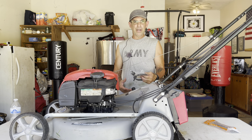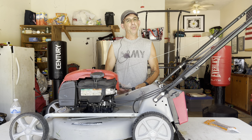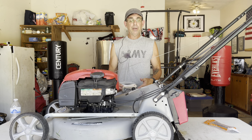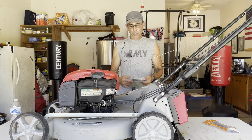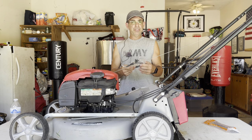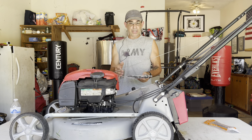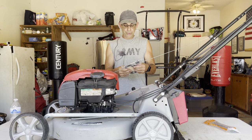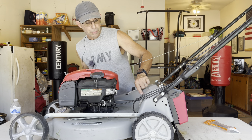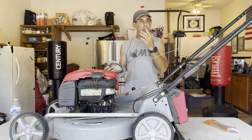When you're talking about this style lawnmower in the industry, we usually refer to them as a push mower - even though this one is self-propelled. It's a little 20-inch pusher; it could be 21, 22, 19, or 18 inches, but we call it a 20-inch pusher. We're going to install a new self-propelled cable which engages the transmission from the operator's bar. His cable is trashed. The model is 479904 - this is a self-propelled model, pretty cool actually.